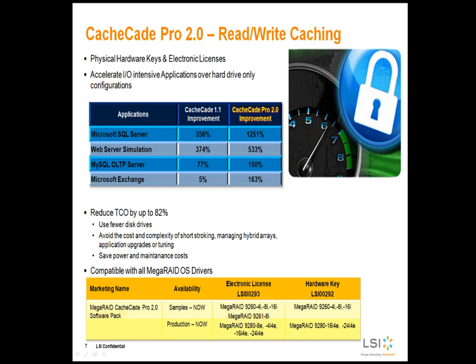Interesting you bring it up, because we get a lot of customers that do have a degraded RAID and are doing a rebuild. A lot of them will increase the rebuild percentage in our GUI, but typically it defaults to 30%. We really recommend that they finish the rebuild first before they access the system. Sure, because anything can happen in a vulnerable state, and then you're totally down and you've lost your data unless you've backed it up. If you have that luxury, that's great. If you can, that's definitely the best idea.